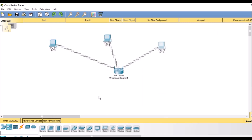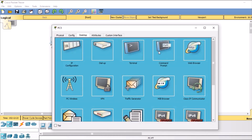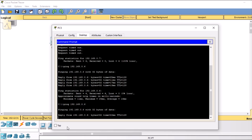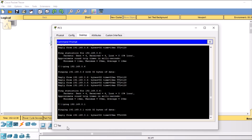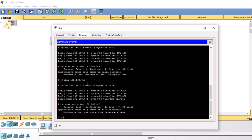You can already see these wireless connections among the PCs. We are going to go to the first PC and ping another PC in the network to check connectivity. Go to the command prompt and ping 192.168.0.6 — press enter. You can see we are receiving a reply. We can also ping our router at 192.168.0.1, and you can see we are receiving a reply from the router as well, confirming they are connected wirelessly.